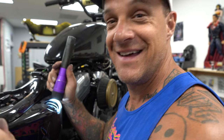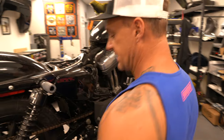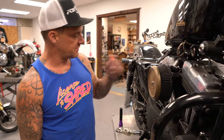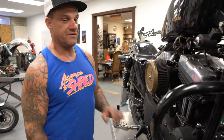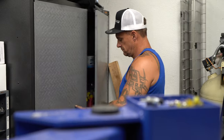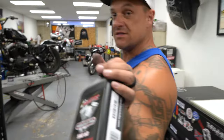There's zero oil in it. Holy shit. Probably all in the case — this bike's been sitting so long that these things will sump down into the case. If I put oil in it, it's gonna fill it all back up. It does not have a new oil filter on it, so I don't think the oil was changed or any of that. We haven't really done any work on it except Richard took the exhaust off and I messed with that wiring harness. Richard's gonna need the good stuff — Klotz Racing.